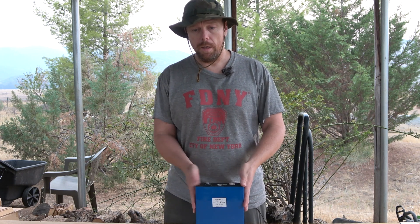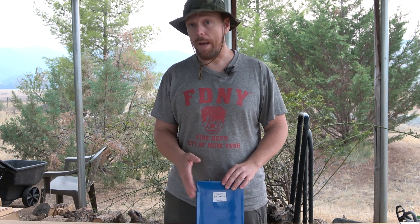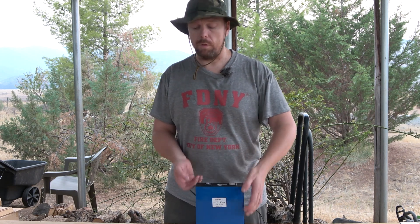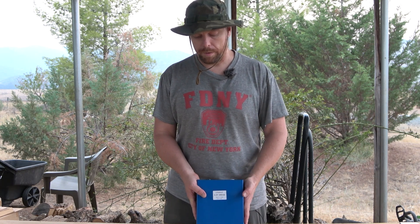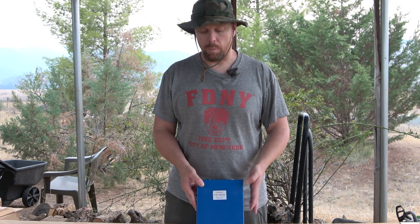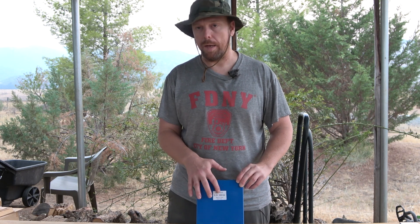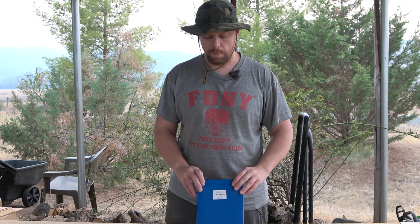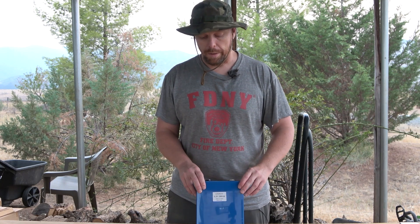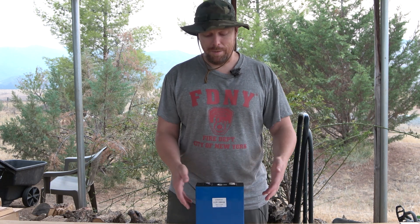These cells are also great for battery backup and solar — 16 in series with a basic inverter could run an entire house. I only have enough for one battery right now. At $110 to $120 per kilowatt hour, the pack will be around 90 kilowatt hours and provide about 280 miles of driving range based on my rule of thumb for the Ford Ranger Electric.